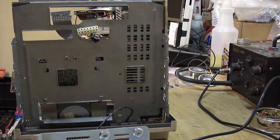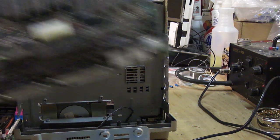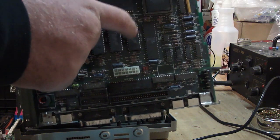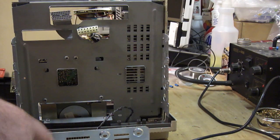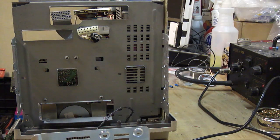I junked it. And then I did save the ROM set from this logic board, so I can convert this unit, which is this board right here. I can convert all three of these chips to the more standard 1.4 megabyte, because you have your ROM high, your ROM low, and then your IWM, which will be replaced with the SWIM, which will give it the 1.4 megabyte capacity. So, without further ado, we are going to grab the screwdriver wherever I put it.